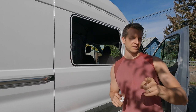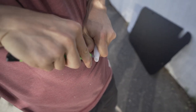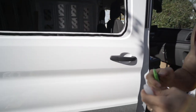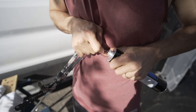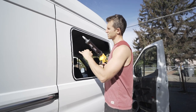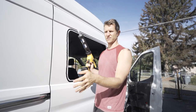Then we will do the most intense part: the urethane adhesive. Van Windows Direct sends you these little nozzles with the V notch already cut out. So we got the perfect little V notch. This stuff is very thick and viscous, so I'm going to punch a lot of holes in the cartridge. We want to start at the back middle upper corner — ideally it's one continuous bead, and we want the junction to be at the back middle so that if there's any water, especially when driving, it's not hitting it at the front and can run off. A half-inch bead is what most people recommend.